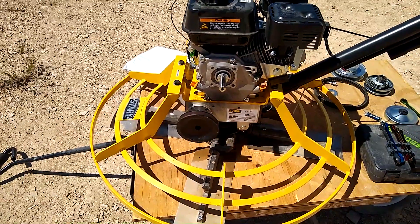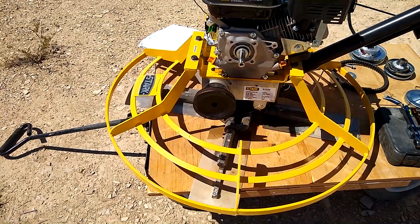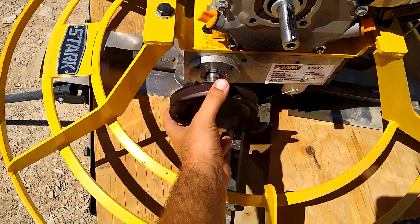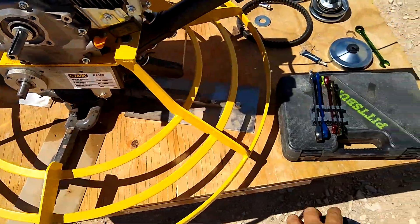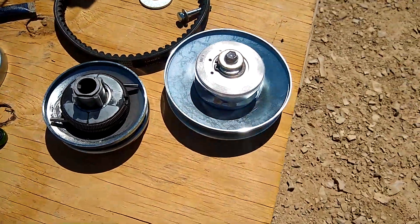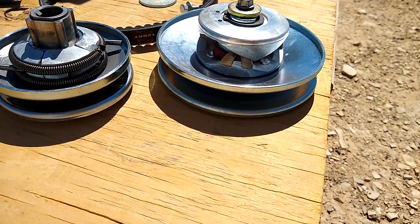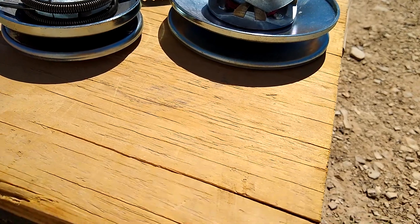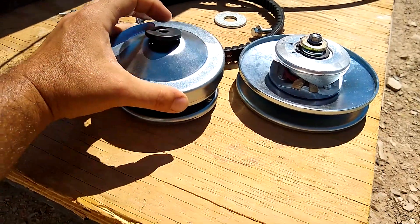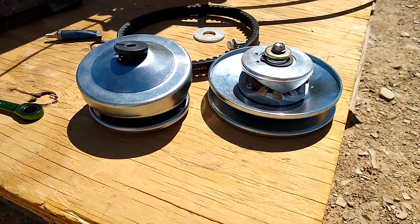I'm still pursuing them to see if I can get the clutch, but anyway what I've decided to do is get a CVT clutch — usually used on motorbikes and go-karts and stuff like that. So we're gonna replace this pulley here with this one. It's got a little bit of magic in it — basically it starts off one size and then as it speeds up it actually changes its size, so your gear ratio between this clutch and the other one changes as the speeds change.